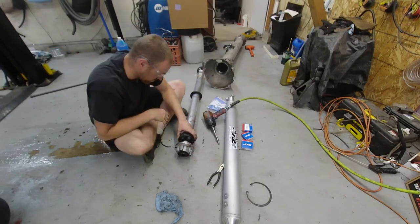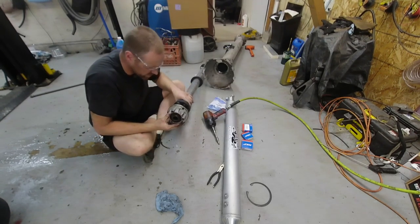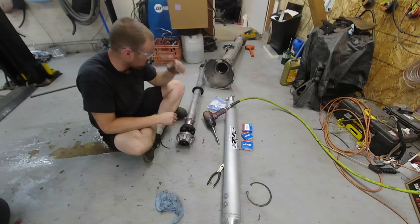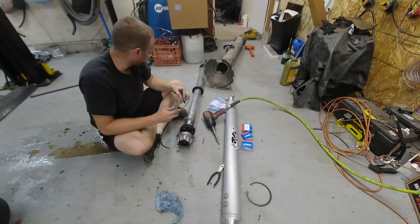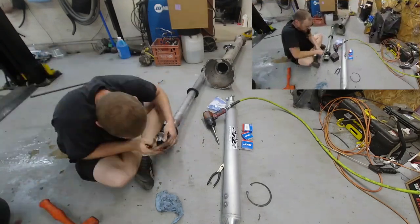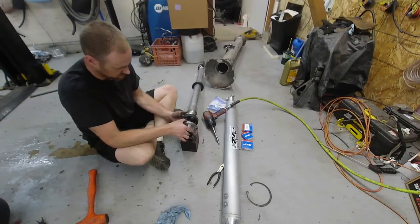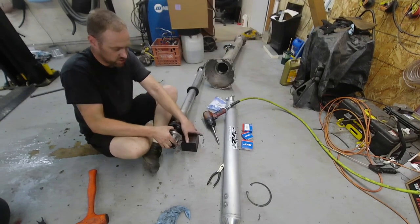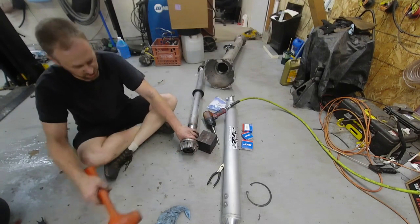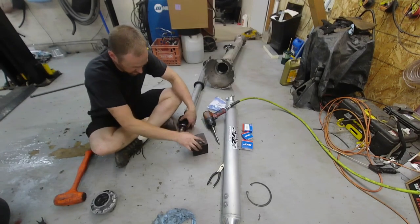I don't want to do it, but I'm going to heat things up. I'm going to pull this apart, heat up this flange to loosen up the Loctite a little bit — otherwise I'll just fight it too long and possibly strip things out. Typically these come off easier, but it's definitely not coming off easy on this vehicle. I added a little weight behind it to help, and this one was a little bit rusted, which is why it gave me so much trouble.